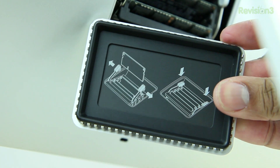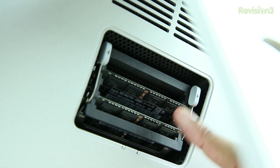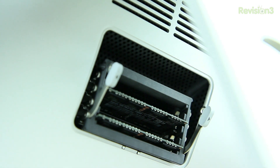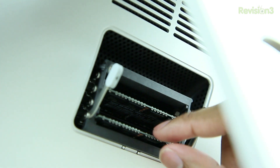As you're setting that cover to the side, you'll notice that Apple did print the instructions on how to install or upgrade your new RAM inside of there, but I'm about to walk you through that very quickly. Take a look inside the RAM capsule — you'll see two little prongs that you actually need to push out at the same time, and that will lower the RAM capsule. To pull the RAM out, you simply slide them out directly towards you.